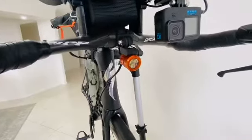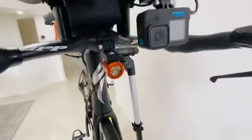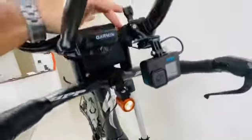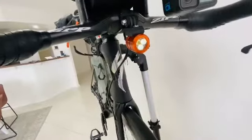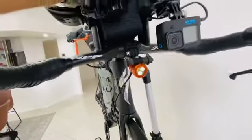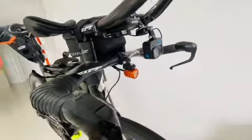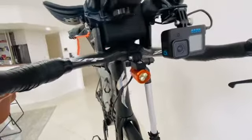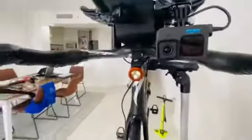It's an ultra-low-speed light built for bikepacking — you hardly need the wheel moving for it to start working. 1200 lumens, it's bright. It's got a light switch so you can turn it off, and it's got a capacitor bank so in the off position it maintains light after you've been riding for about an hour. So if you need light to set up camp it does a great job. If you're riding during the day and don't want it lit up, turn it off, but it'll be flat by night.